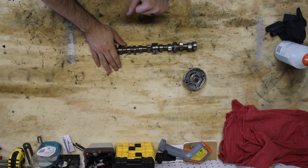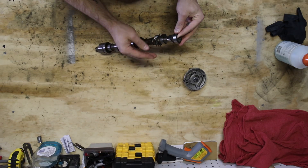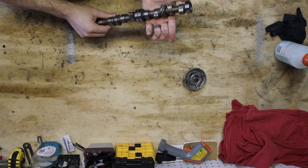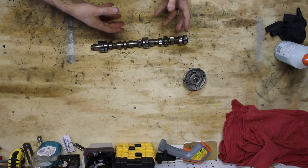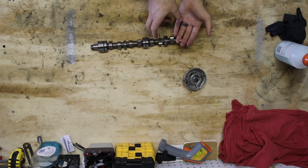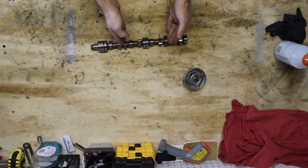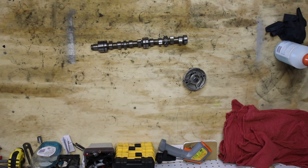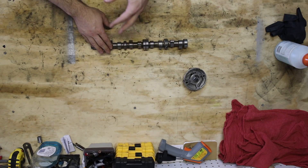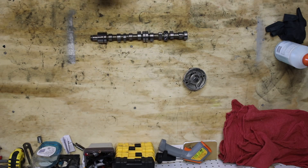There's one more thing to cover: this geared piece right here. It has angle-cut gears on it and it connects to your distributor. That's how you time your motor — by rotating the distributor and making adjustments on how it meets with this camshaft and when it fires the pistons. On these older cars this is all very mechanical, whereas newer cars have a computer that does a lot of the calculation and timing for you.